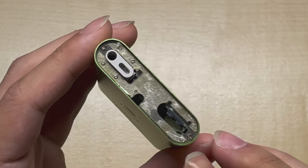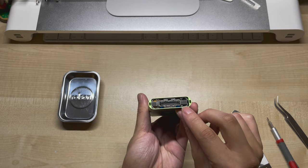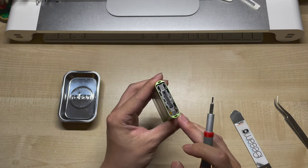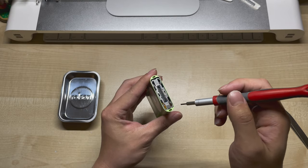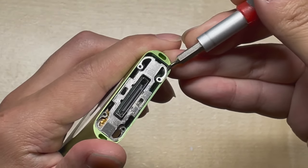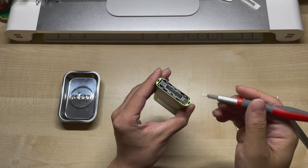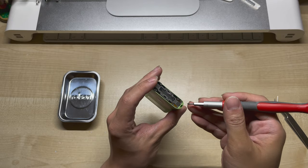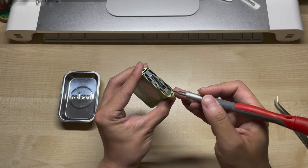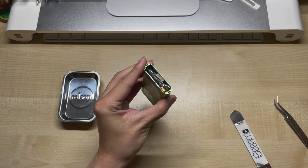The internals of the iPod are held in place by two Phillips head screws at the top, but before we can remove those we need to disconnect the click wheel which is held underneath this metal clip. To do that we're just going to use a very small flathead screwdriver and pry. Now do be very careful because the click wheel connector is on this side and if we insert too far in we can end up damaging it permanently. So we're just going to start on this side first, and gently go down and pry upwards. We only need to remove one more of these clips and the whole thing will fall out — generally I tend to go for the one on the back because that's where the ribbon connector falls. And just like that the clip is out.